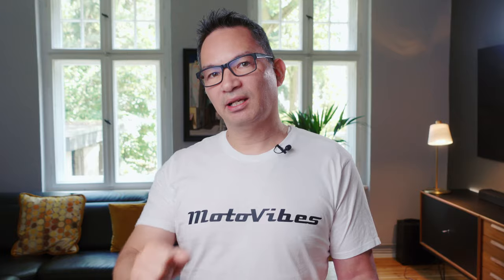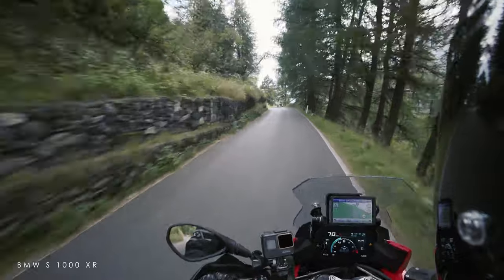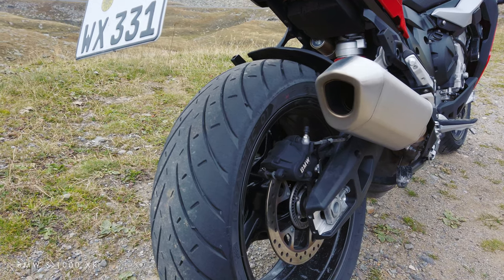Why would you want a small wheel on a motorcycle on the road? It is much easier to turn a bike when it has a smaller diameter wheel. If you hop on a bike with smaller wheels, it almost feels like riding a bicycle — if you want to lean into corners really fast, that small wheel will help you do that. Also, the selection of tires available for that size is huge, since many street-biased bikes run these wheel sizes — from long-distance road tires to track tires and the full range in between.